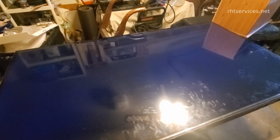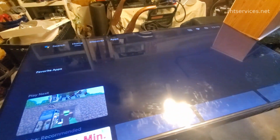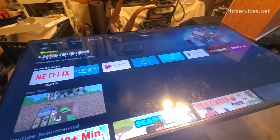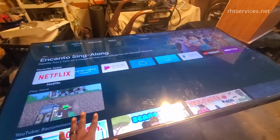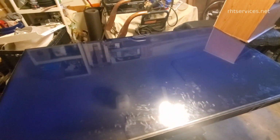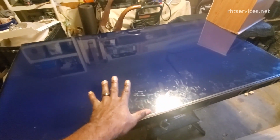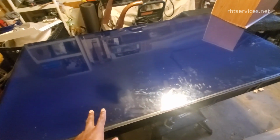So yeah, the TV does power on, backlight perfectly fine. As you see, stuff comes up and then it does that. No input, no nothing, just goes black, comes back again, and then it'll do it again, I think. Maybe, maybe not. Okay, this is weird, because previously it would come on, go out, come back on again, go out, and it would continuously do that until it quit working. Ah, there we go. So it went out again, and then usually this time it will go out and stay out. I'm assuming there's a background worker on the TV that monitors the activity of the TV, and when it sees it not doing anything, it shuts it off as a way to let you know something's wrong. And so eventually that'll do that.